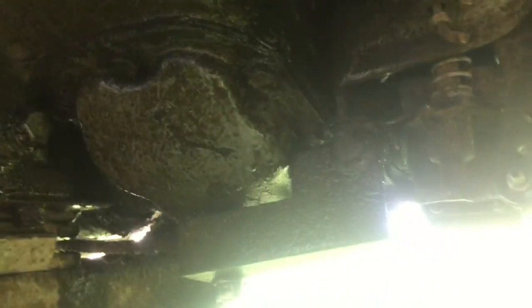Here's where it's going to get ugly. This T90 transmission that was installed here — they've got a cross member that looks to be off a 3A, bolted up and shimmed out so they could put the T90 in. That is an amphibious GPA transfer case — how about that? And you can see everything down here is leaking everywhere, slinging gear oil underneath the body. Rear differential — same thing, all leaking seals are bad. Have to drain that out and see what's up with that.